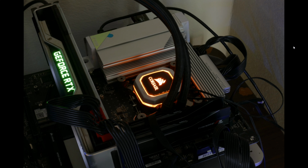We do not just go in and type in 5,600, as Intel recommends, it can go up to whatever. AMD has their own thing. We just use whatever's JEDEC default. So for DDR5, we're using 4800 on every system with DDR5. And this motherboard supports DDR5, but we also wanted to add in some non-XMP results with DDR4.